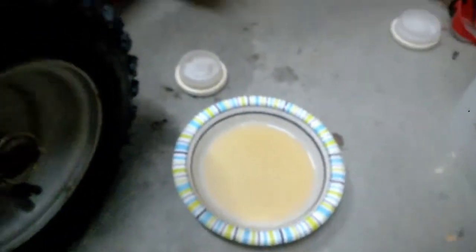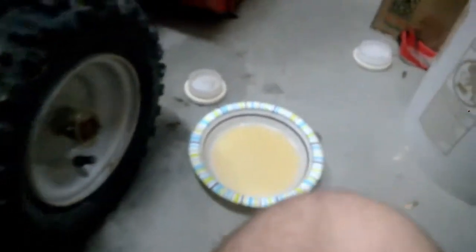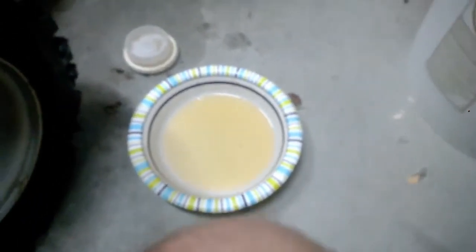I've also got the gas drained. There wasn't much in it, but it's better to have it drained into a container than drained all over your floor — it did spill a little bit though. I'm going to get this other new hose clamp on the other line, reattach it, make sure it all works, make sure it doesn't leak, then put the fuel back in to confirm there are no leaks.